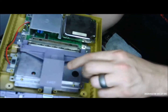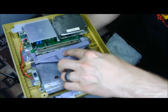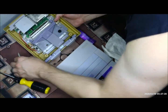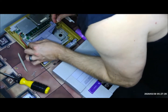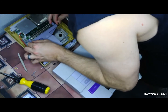I'm not going to tape it, but the reset button is springy like we wanted it to be before. Again, it's still kind of messy, so just make sure it goes into the groove. Hold on. And we've dislodged it again, because I ended up breaking a piece off because that Super Nintendo guy gave me erroneous information about it. So we try to put it back in again. I may have to end up repairing this because it may not be able to hold the pin anymore.